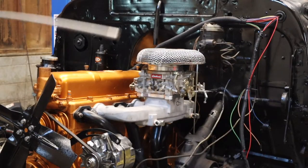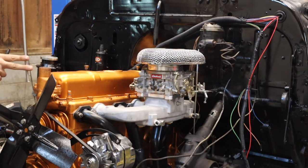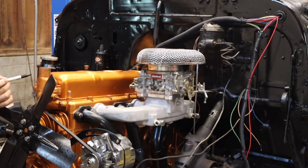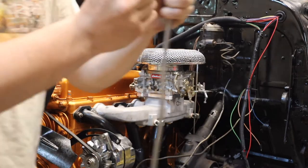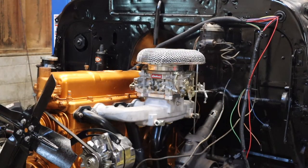We'll have to see — I don't think it's going to work behind the water pump pulley, I think we're just going to end up shooting around the thermostat. I've already got a flare on the end of this but I don't have the nut on it yet. I think we're going to start with the top fitting at the actual thermostat housing — we've got to run a 90 on it, so I'm just trying to mark kind of where I want my bend to start. I have this little Harbor Freight tube bender that goes up to three-eighths, but we'll have to see whether or not it'll bend this stainless steel.